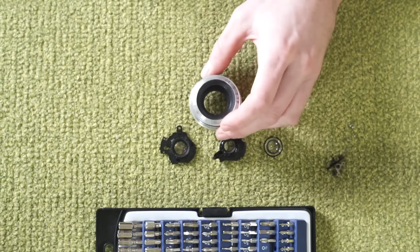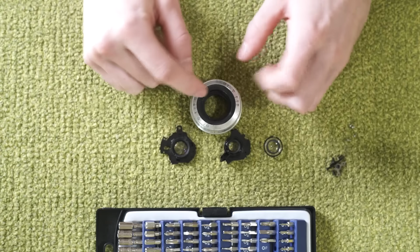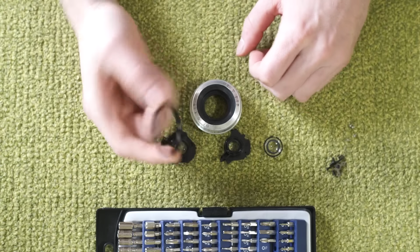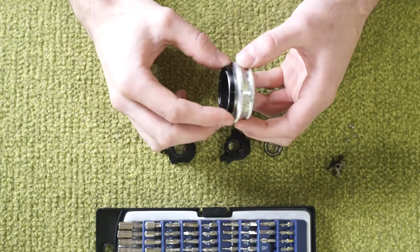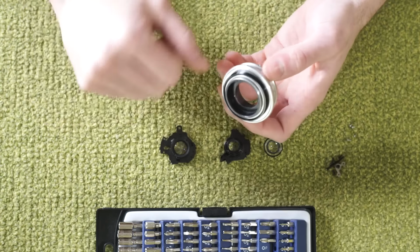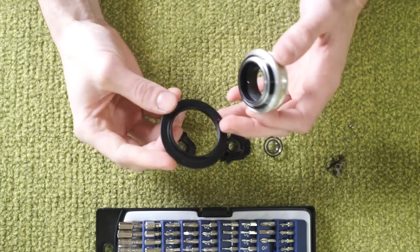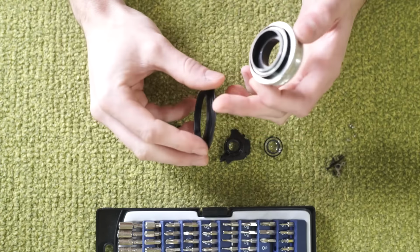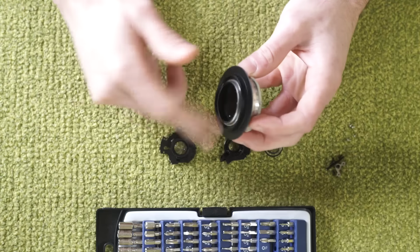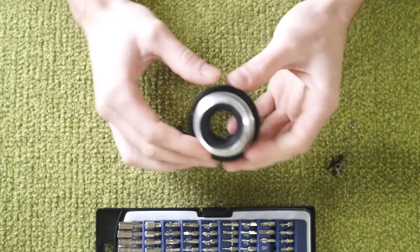And with this, I can mount all these components, which will fabricate the adapter from these components into this lens. And then I will use a standard M39 to M42 adapter screw here. So this will just spin on like that. Now this is M42. Then I will use an M42 to E-mount adapter, and it's 1 millimeter thick, so it adds 1 millimeter to whatever our flange distance is. I'm gonna screw that guy on. Now we have all of the basic mechanism of our lens.